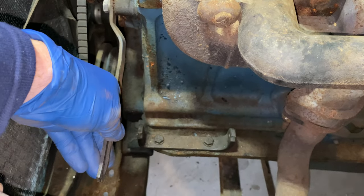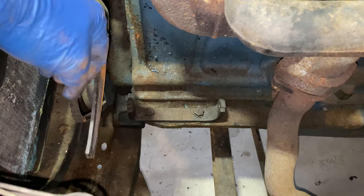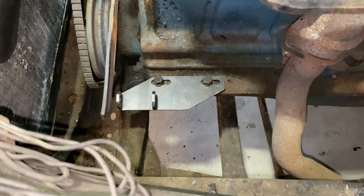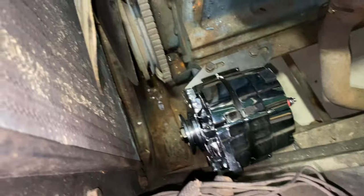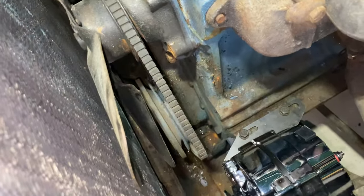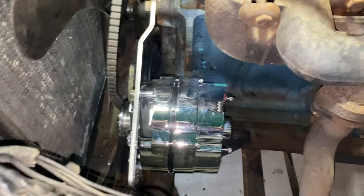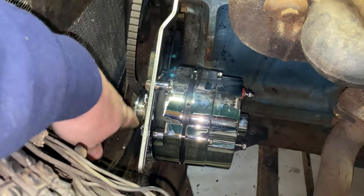The generator and its wiring have been removed. All that's left is the bracket and the base mounting plate, which we'll replace with the one from Vintage Garage to fit the alternator. The old bracket is out and the new bottom bracket is in. The new alternator is in with the bolt — I'll put the washer and nut on and tighten it up, then pivot it to line up with the belt, adjusting the bracket front and back until it lines up perfectly.